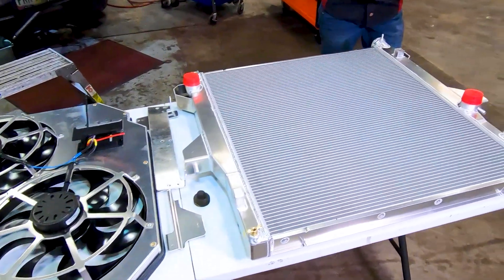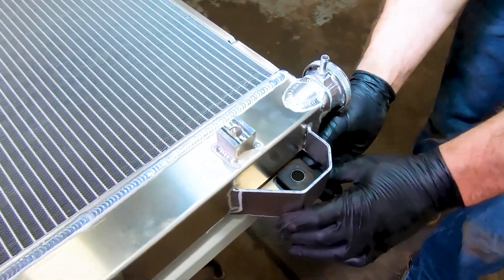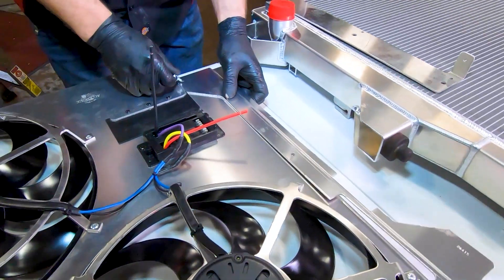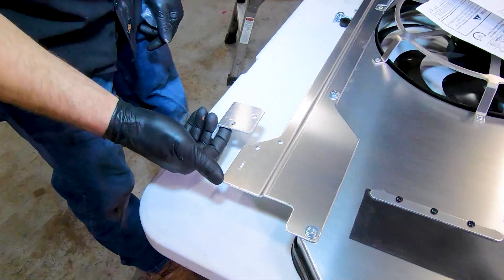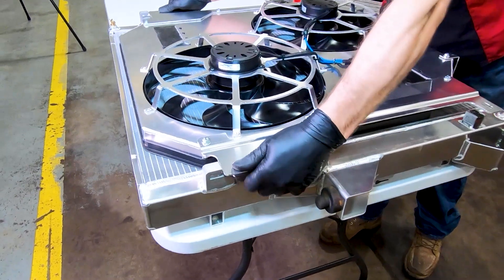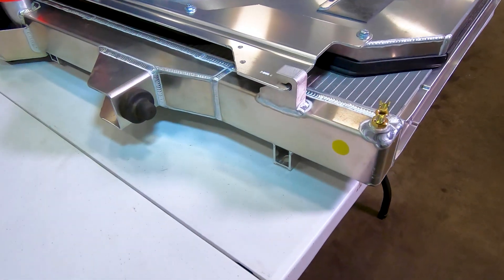Now it's time to prep the new FlexLite radiator to go into the truck. You're going to pull the rubber isolators off of the old radiator to go on the left and right side mounting pins. You're also going to remove the upper radiator isolator and install that into the new radiator. The FlexLite electric fan comes with side brackets — bolt these to the fan first, and this allows you to attach the fan unit to the new FlexLite radiator. There's also an upper bracket which attaches to the top of the fan unit. If you have a 2003 model truck you'll need to also install this bracket for the overflow tank — the later trucks do not need this bracket. With the brackets installed, the fan is positioned onto the radiator. Slip the lower brackets into the bracket that is part of the radiator. You will need to compress the bulb seal that is on the fan slightly in order to get a snug fit into the brackets.